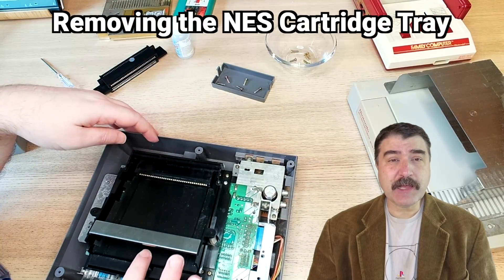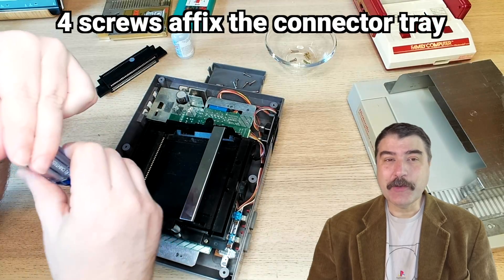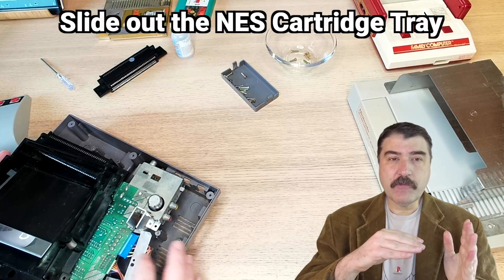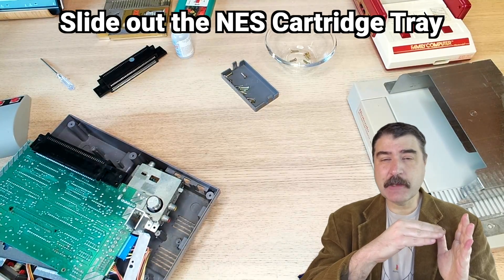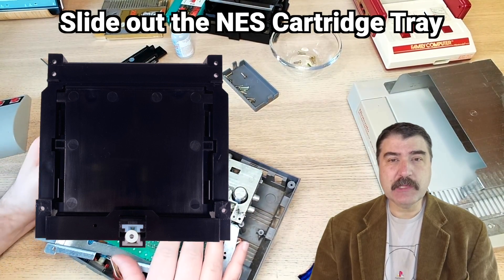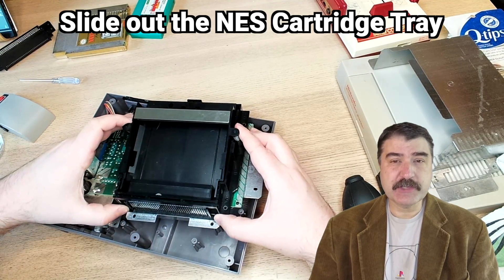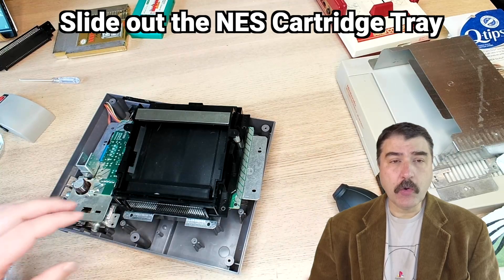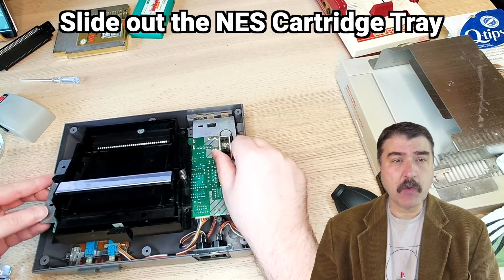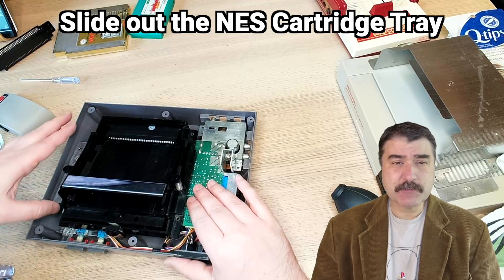Then you are going to see the plastic cartridge tray mechanism — it is spring loaded and it is awesome! In order to remove the tray, you need to remove four screws that hold it in place. Then you can move the cartridge tray by sliding it forward and setting it aside. It is important to note that there is a trapezoid-shaped lip on the front of the cartridge tray that needs to be placed under the lower RF shield in order to be properly aligned, or it can cause some bowing or stress and affect cartridges from going in and locking down.